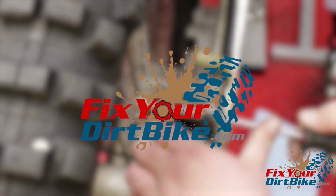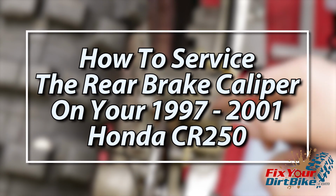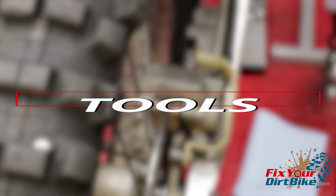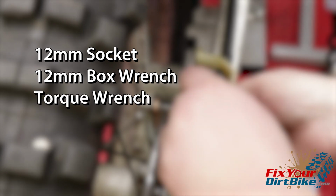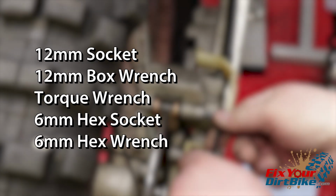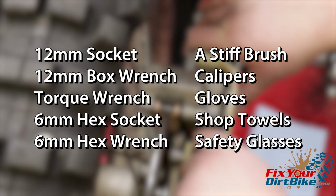Hey, this is John with FixYourDirtBike.com, and this is how to service the rear brake caliper on your 1997 through 2001 Honda CR250. The tools you will need are a 12mm socket, 12mm box wrench, torque wrench, 6mm hex socket, 6mm hex wrench, a stiff brush, calipers, gloves, shop towels, and safety glasses.